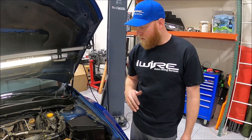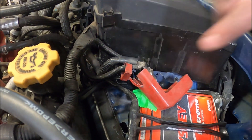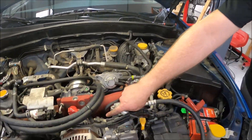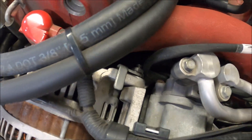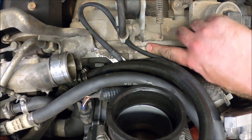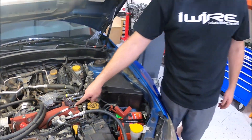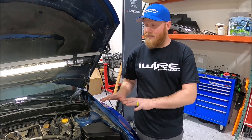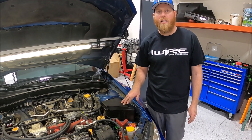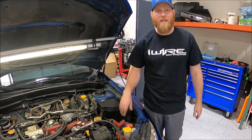Now that we have the basics installed, let's do a quick overview. Our main junction point we tucked down here. The next cable we ran was where the battery meets the chassis — super important. Then we did the alternator because the alternator is grounded based on the housing. Then we went to the back of the block to make sure the block itself is well grounded. And then finally, and most importantly, the upper part of the intake manifold where your ECU grounding happens. Make sure they're all combined — it doesn't necessarily matter exactly where things touch these parts as long as they touch them somewhere. Routing isn't that important; we picked what we thought was most stealthy, but if you want to run it on top, that's fine too.